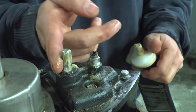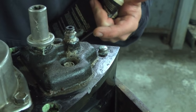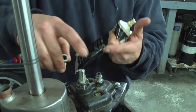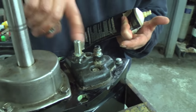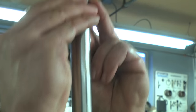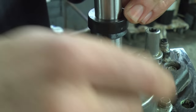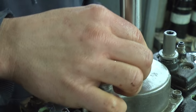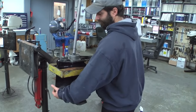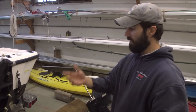You don't want to put too much grease on the top of the drive shaft for the same reason — you have two pieces meeting in this coupler and if you've got grease in there it's not going to go anywhere. Be sparing with the grease. Slide it down, use the little installation tool to push it all the way down until it just touches. Now we're ready to take this out and put it back in the engine.